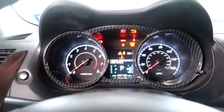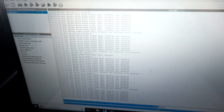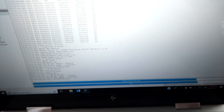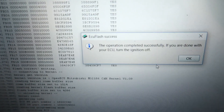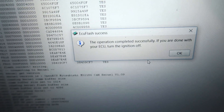Your screen will go a little crazy but just leave it — the fans are going to kick on and it's going to look like a Christmas tree, but it's okay, let it do its thing. Make sure your laptop has power and your car battery has power as well. Do not touch it. It's loading — 78%, 84%, almost done. If it fails for any reason, do not turn off the car — you don't want to break your ECU. It says 'Completed successfully.' Click OK and turn the ignition off. The base map has been loaded onto my ECU.